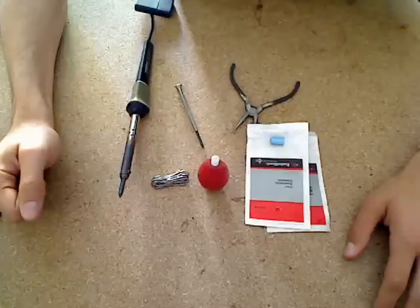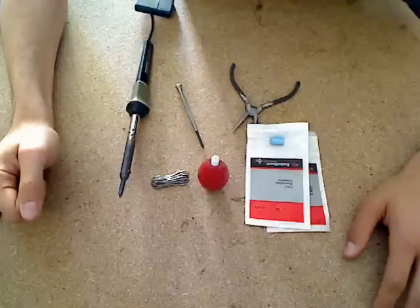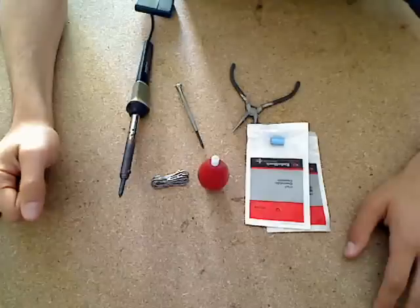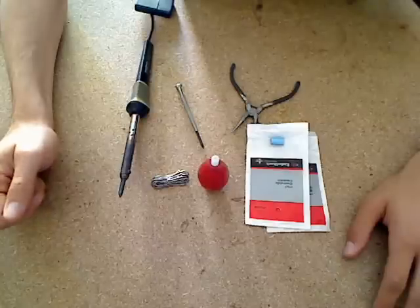If they have been burnt out, then you need to follow the video. There are other ways of knowing if you need to replace these capacitors. People have reported that they get a loss of picture reception and the quality reading constantly jumps anywhere between 0 and 99%, or you can have loss of some stations, bad or scrambled signal messages on the television, or constant pixelation.